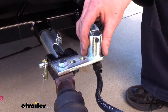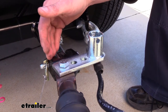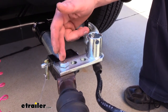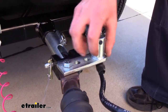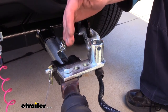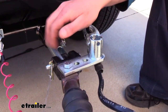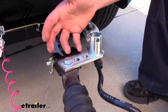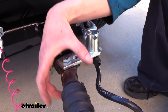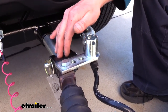It's going to come with all the hardware you need to get it set up, as well as various adapters for other manufacturers' tow bars. In most cases, if you're using this with a Blue Ox tow bar, you'll remove the bolt located right here, then pick the most appropriate hole and positioning because this does pivot around that bolt to where it lines up best for your CarGuard — and again, that's mostly dependent upon the distance between your two connection points on your base plate. For other manufacturers, there are other brackets included. If you have a round style bar, there are U-bolts with clamps that can clamp right onto your arms, and there are L-brackets and others for different manufacturers.